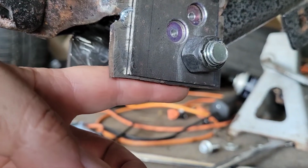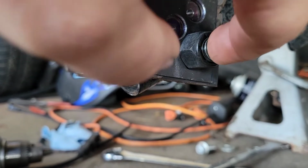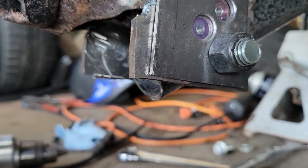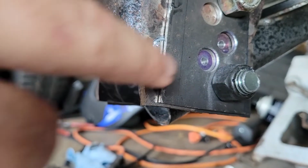And once those are lined up, I actually measure on the inside how far it is from the bottom and how far it is from the front here, and I mark it over here on this side, and then I drill it from this side because I don't have any bits that long that are sharp that do it over. So that's how I just transfer it over, make these work, and then do these 2.